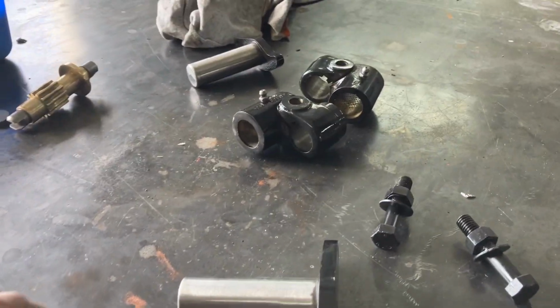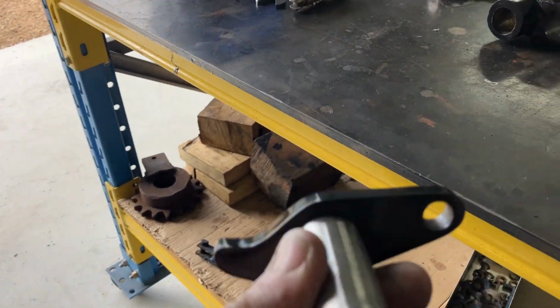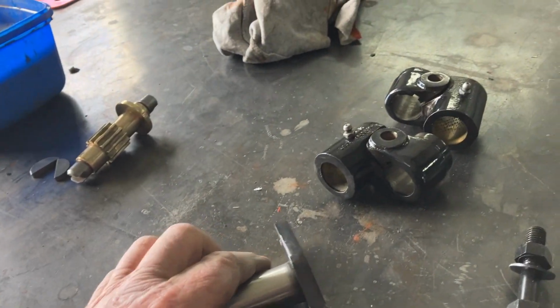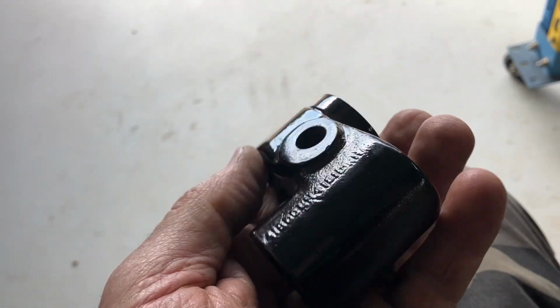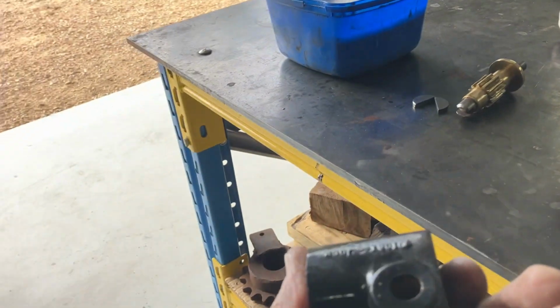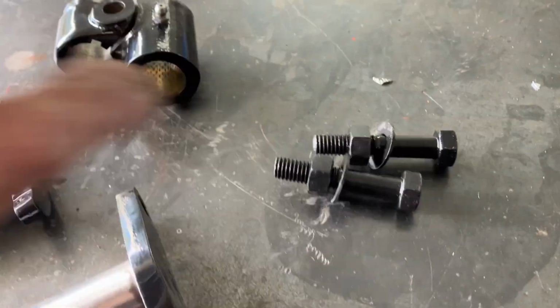Well, that's those brake components powder coated, guys. They come up all right. Bit thin in a couple of spots. I was a bit low on air pressure. But anyway, they're still warm, actually. They come up all right, as I say, a little bit thin in a couple of spots there. Cleaned out the grease nipples, put them in. We can basically put these in, I think. Oh, and I cleaned up the nuts and bolts and blacked them.